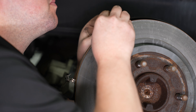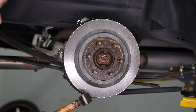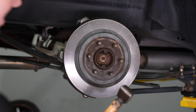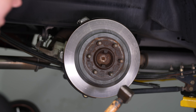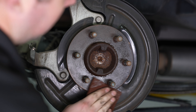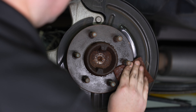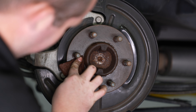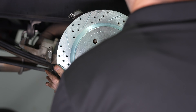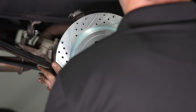Go ahead and get the top shim done too. We already sprayed some penetrating fluid, but a hammer is going to be the fastest way to get the rotor off. It never hurts to clean off the surface of the hub where the rotor mates to — some sandpaper or other abrasive works to knock the rust off the surface. Then the smaller of the two rotors will go in the rear, with the R labeled for the right.